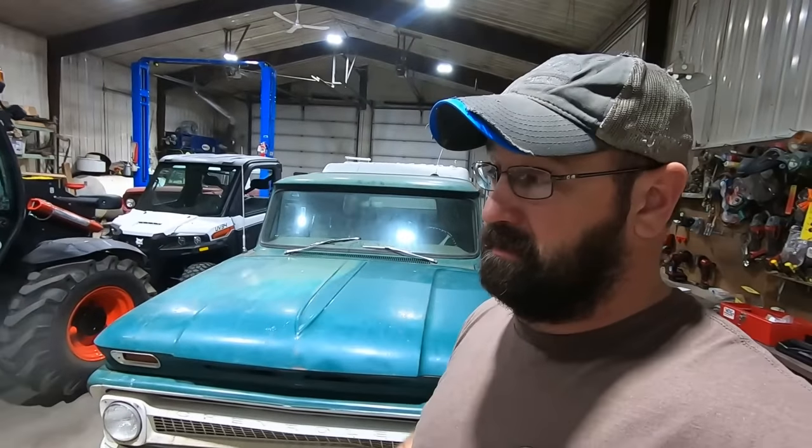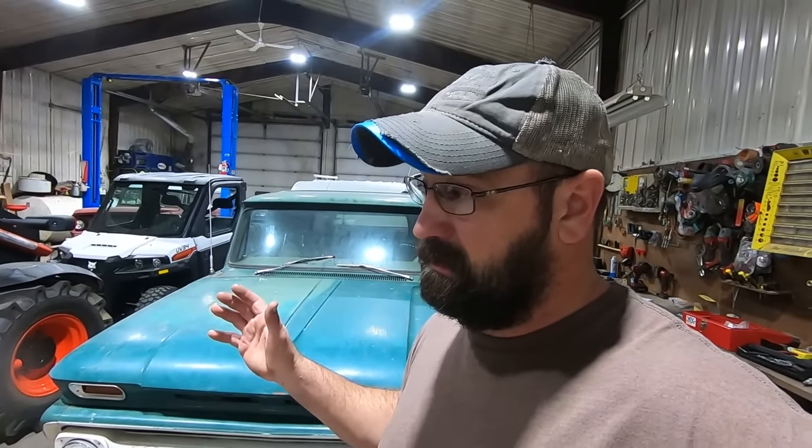So we're gonna have to get some parts coming. We're gonna have to put it up on the hoist, see if there's a bunch of mouse nest in the clutch. We gotta do something with the carb, we gotta drain the gas, it stinks something terrible. The brakes are pretty subpar, so we should probably see if there's any fluid in there and then see what's leaking or if we got brakes that need to be adjusted or what the deal is. So no ride on the block. We'll maybe take a little bit closer look at this thing and yeah, probably get some parts coming.